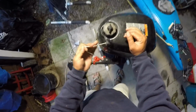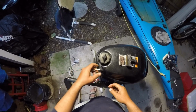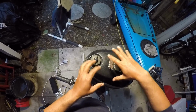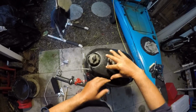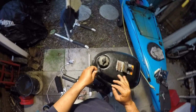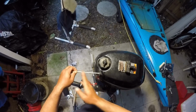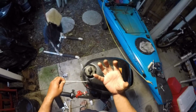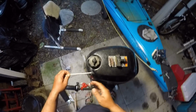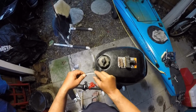Okay, here's the trick. What you need to remember is, you can see that's the dead slack there. It's unwound, and then it's just barely got to the point where there's no slack on the line, it's loose. Then you could pull just a little bit, and that's the stop where the clutches are just getting ready to engage, okay?